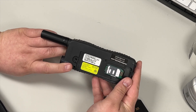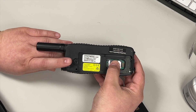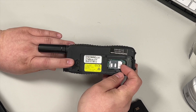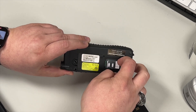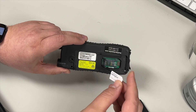In order to get your old SIM card out, you are going to push down ever so slightly with your thumb and slide the door back. You'll hear a slight click and then it will pop up a little bit. Then just hinge this up and pull out your old SIM card, and then you reverse it to get the new one in.